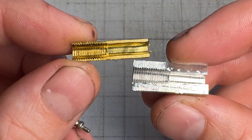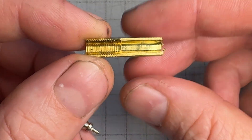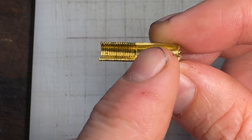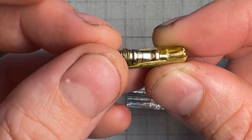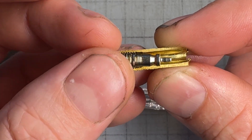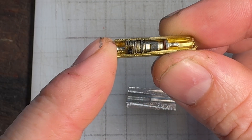I've created a cross section of what your adapter is going to look like when it's finally completed. Essentially where the two different drill sizes meet creates a step, and that step is where the seal will rest against on the Schrader valve. When it's done correctly, the tip of the Schrader valve is protected as well.